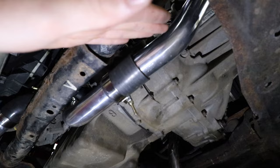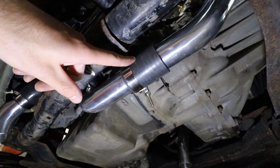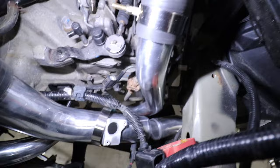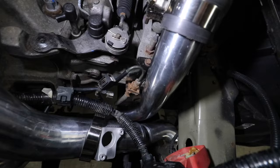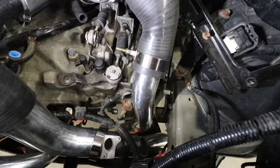For the straight silicone coupler, it was easiest to put only one hose clamp on one side of the pipe so I could leave the other side loose to play with where it lines up to the turbo. That 2-inch T-bolt clamp is actually on the Subaru right now because mine broke, so I need another one. The pipe curves up towards the turbo - and from the top you can see how close it is to the clutch slave line and brake lines.